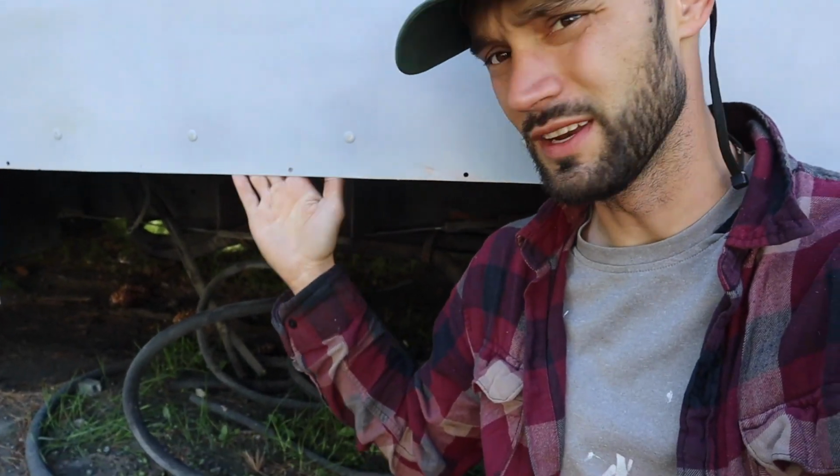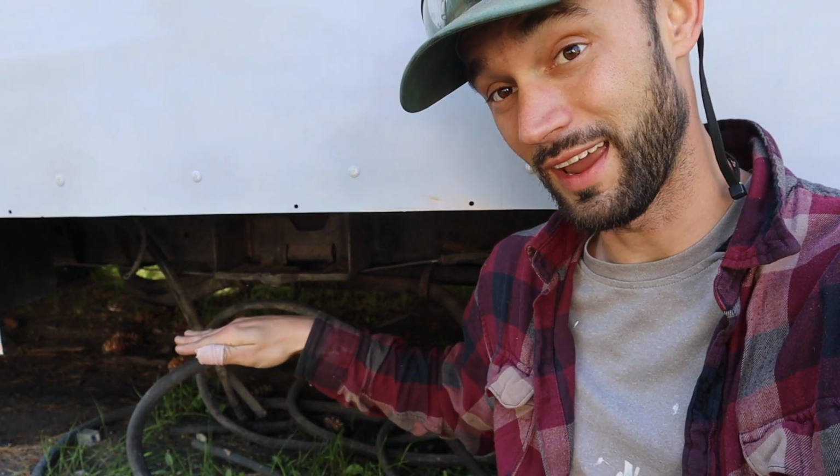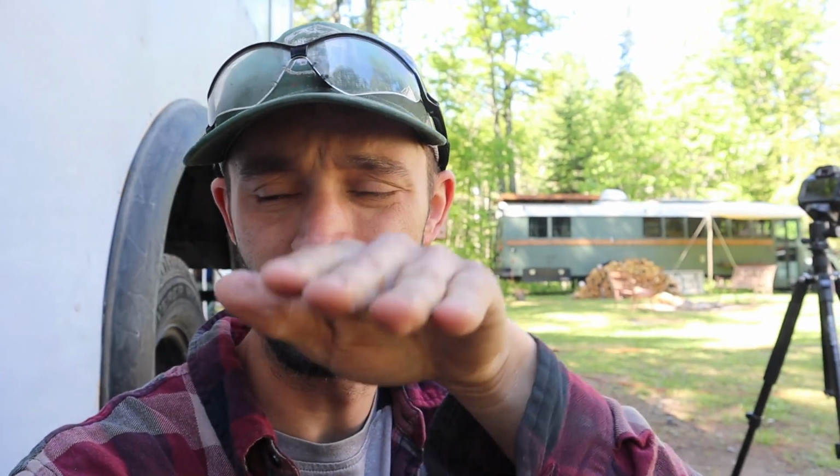The first task for me to get this thing completely sheet metaled off is I need to figure out my depth and then my back angle. Because if you ever look at sheet metal on different buses, you'll notice that there's a flange here where the sheet metal's bent. The reason it's bent is because it gives it strength on that bottom edge. So what I'm gonna have to do is take this piece of sheet metal right here, cut it to my dimensions, make the angle on the bottom, and then I can rivet it back in to the top and then rivet it into the angle, and then we can get a nice flat piece here and patch that off so that we can get ready for painting. So I gotta get some metal cutting to go and get this piece in.